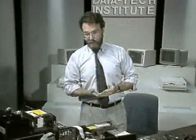When you have a disk problem, first check the diskette. Then clean the heads on the disk drive. Try swapping the drive after that, and if you're still not having any luck, swap the controller and the cable. And don't forget that sometimes a simple reboot can reset the drive system, solving the problem.